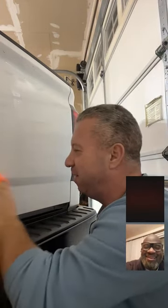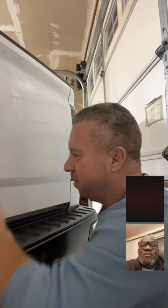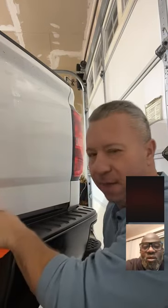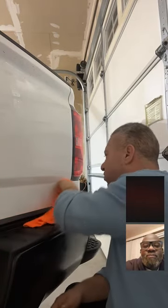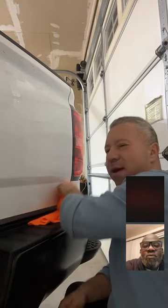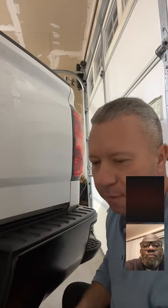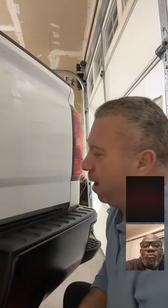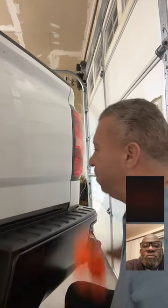Here's something I've actually done lately. For instance here, I'm using this because I'm trying to get all that crap off. I'm using it like 70-30. But Mike probably knows, you know the general body shop wax and tar remover stuff that they sell? I actually mix that like 5-1, and I use that as my IPA. Let me tell you, it's amazing. Yeah, it's good stuff. There's nothing left on that paint. I promise you, the paint is clean.